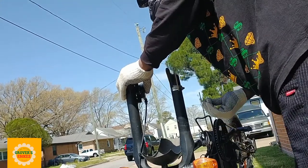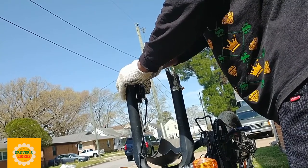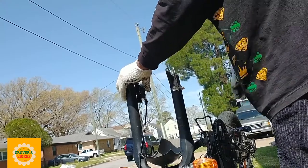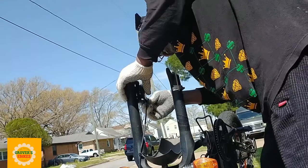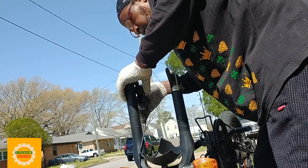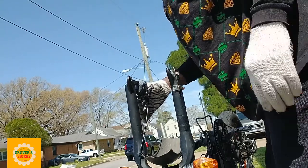So both of those pads go in simultaneously to grab the disc. It's like a simultaneous movement of the pads to grab the disc. So once you pull on that line, make sure that you have it kind of loose so that you can line that pad up equidistant from those pads. You don't want to tighten them up until you make sure that you have your pad equidistant.